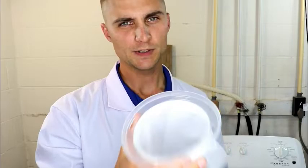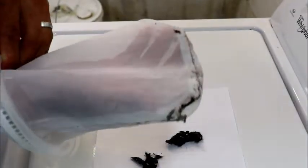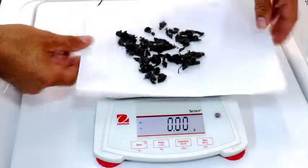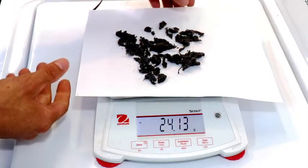Overall it did a pretty good job, but let's go ahead and take a closer look at this and weigh the results. I'm going to empty the filter contents onto a piece of paper so you can see what it caught. If you look really close, you can see some hair and some fibers. I'm going to throw all the contents onto a scale just to give you an idea of how much we actually caught. This isn't an exact science because it's on a piece of paper and the lint is still wet. However, it looks like we caught about 24 grams — and that's with moisture in it, so if we dried it up it would reduce the weight quite a bit.